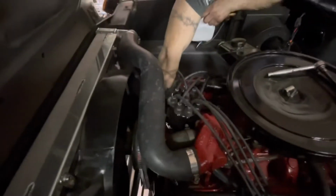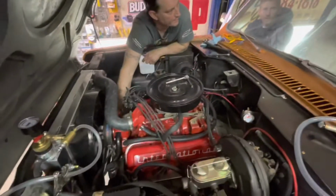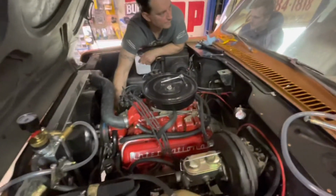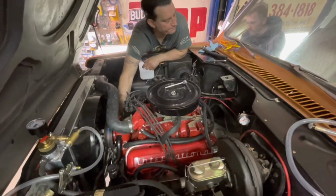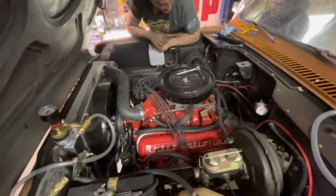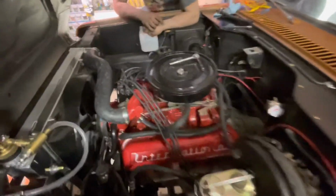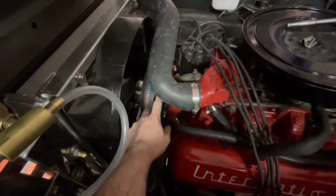I think it's this steel line on the front water pump. Yeah. It's the lower one here. You moved it and it changed tone. Yeah. The rusted end? That rusted end. We found it! Unfortunately. So, reconnect this, but yeah, I think it's that tube. This here is a steel line, same thing on the other side.